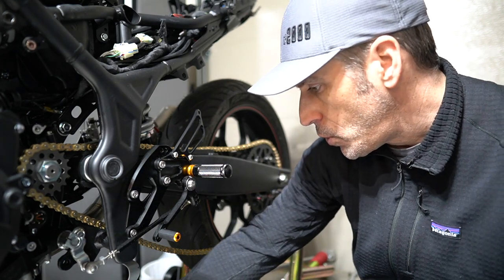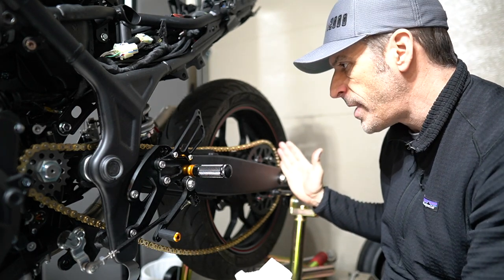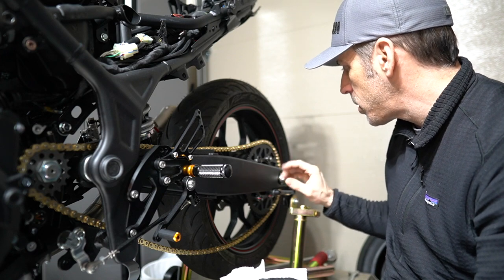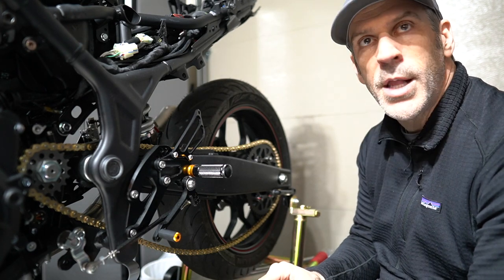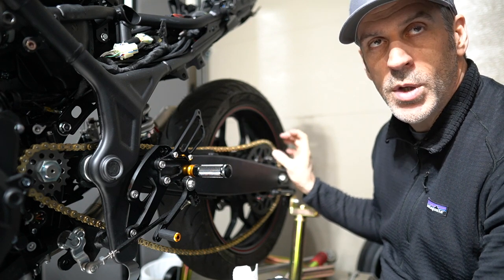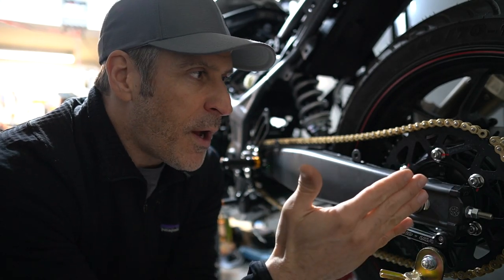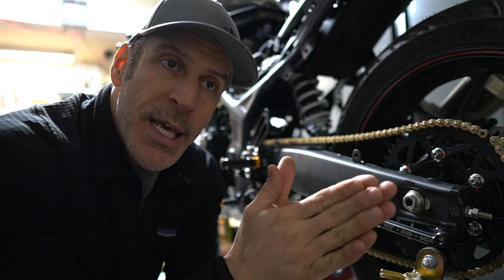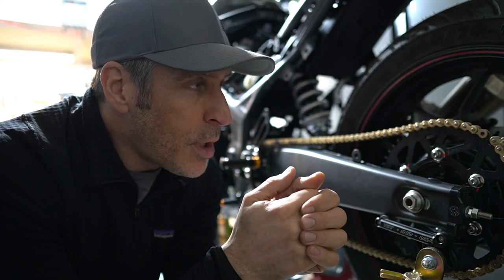Now the chain is on and we'll be able to adjust where the wheel should be. I'm going to start with it pretty much in the middle, giving room to move forward and back once the chain tensioner is adjusted properly. I'll tighten the wheel a bit, make sure it's properly aligned, then cut the chain to the right length. My wheel is adjusted pretty much in the middle of the tensioner, and the 415 chain tends to stretch a bit more than a regular OEM chain.